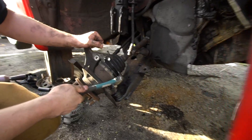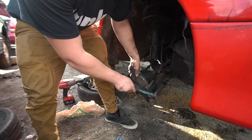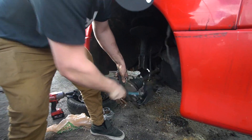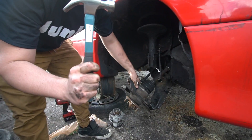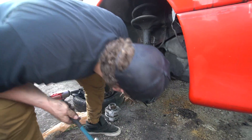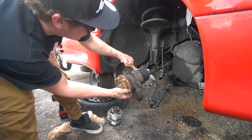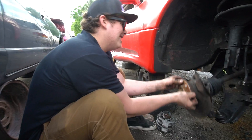You just need that for the wrench, but hopefully the anvil will really do some work because we've got to get it off this ball joint. We have about 30 minutes left before this place closes, and hopefully this axle just pops out. Are you ready? Don't break the dude's hammer now — it's a little crooked. If it breaks it breaks. Wait — it's coming up! This is money!